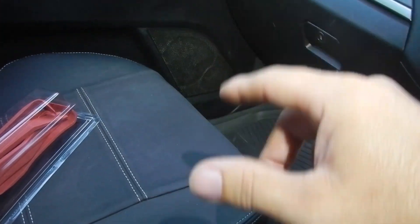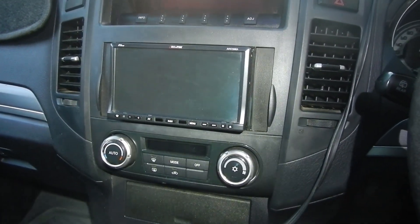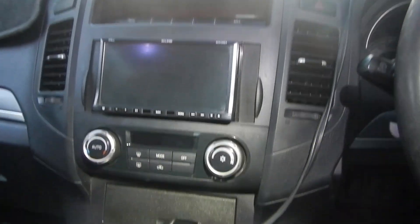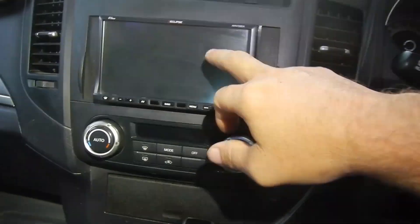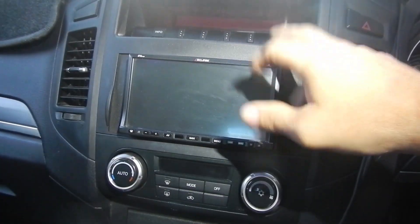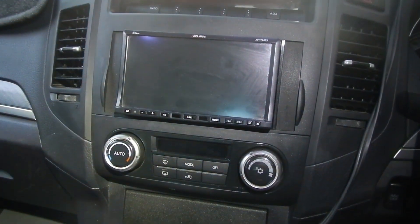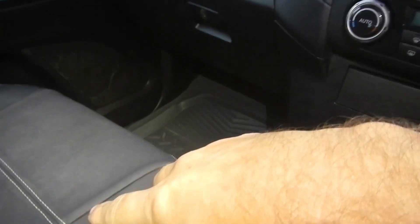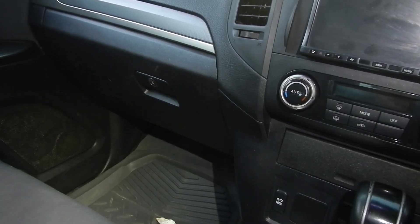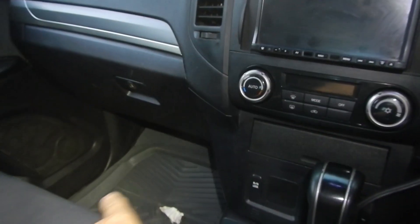These speakers sound rubbish — I think it's got something to do with the amplifier under there and the way it's been connected up. I have another amp to go in, so we'll possibly wire that up this weekend as well. There's also a reversing camera to get wired up. And once we've got the seat out, I'm going to put in a DC-DC charger with a 125 amp auxiliary AGM battery over the back, so I want to be routing those wires too.